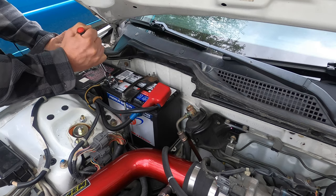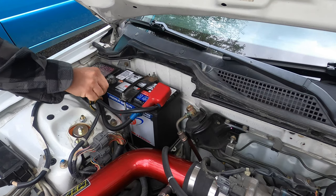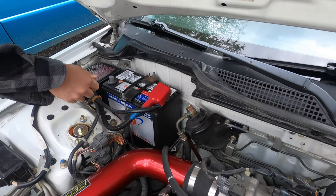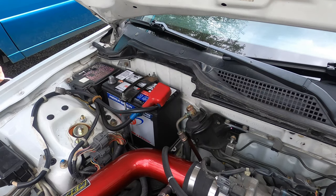In this video we're going to cover swapping the wheel, putting on the hub adapter, setting up the steering wheel, and getting the horn working. The airbag light delete will get a whole other video because it requires one extra step that the Xterra and the Ranger didn't require. Before you start, make sure the wheels are straight and disconnect the battery. Let the car sit for 20 minutes — this is super important whenever you work with any of the airbag components. Be careful, you don't want the airbag exploding in your face.